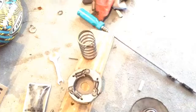Because with the 4.5 gram sliders in the variator and this ZTR spring, which is supposed to be 1,000 pounds, but I'm not even sure because, like I said, I bought it from a private person on eBay. It could be different, and I don't want to dog ZTR, but supposedly they are the best racing springs. This is a ZTR spring. I think they just have some sort of coloring on it, like a red dot or something.